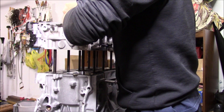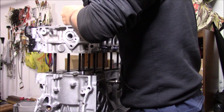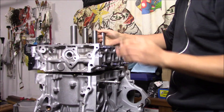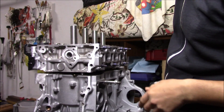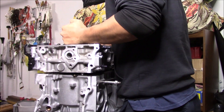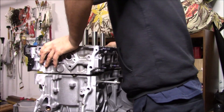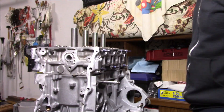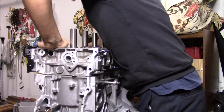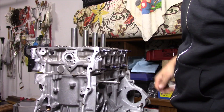As you can see I'm touching the studs a little bit — it's almost inevitable, just do your best. It might not sit flush all the way because the head has to fall on the dowel pins, so work it around a little bit. There we go — just give it a good push and make sure it's flat all the way around. I'll grab a rubber mallet and just tap it to make sure it's completely flat.